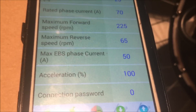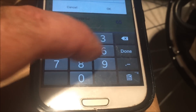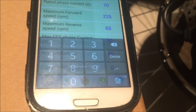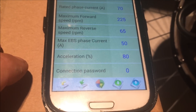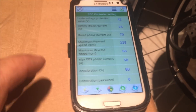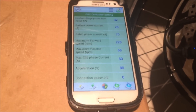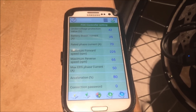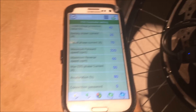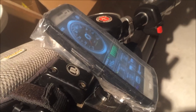Acceleration is the up-ramp speed — how fast it takes off. On a front wheel drive bike like this, you don't want the front wheel spinning out, so instead of full power at takeoff I'll set it at around 80, and it might take a second or two to reach full throttle. Connection password — I don't need one. That's basically the settings, and now we're going for a test drive. I'm going to tape this phone into a baggie and tape it to the bike since I don't have a stand. You can see I've taped the phone to the front of my bike.